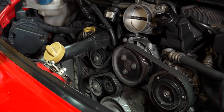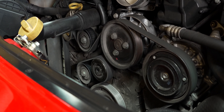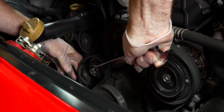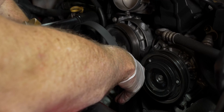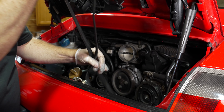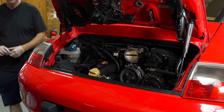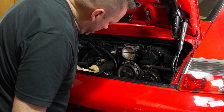This car does have new brake discs and brakes on it. It's a little bit greasy here and there which is a little typical on this back side. Everybody in the comments is gonna say it doesn't look like it has 59,000 miles on it, but think of the age of this car - I think it was 2000 or 2001. These hoses are deteriorating a little bit but they're not bulging, not ready to be replaced just yet. Let's let it down and take this belt off and start it to figure out where the noise is coming from.